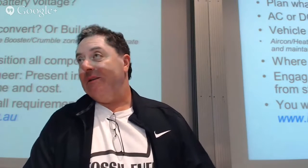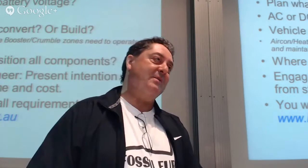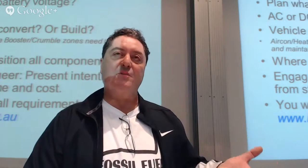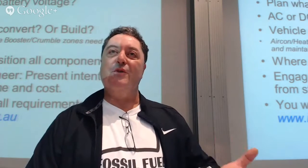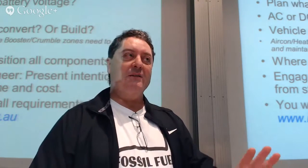AC or DC: which way do you want to go? AC is good because of your regen facility and charging your batteries. DC was a bit cheaper. At the time we started this project, AC wasn't that much more expensive, but the problem with budgets is if you allow something, before you know it, you're way over budget. So we stuck to DC. But if we were to do it again, I would definitely now go AC.